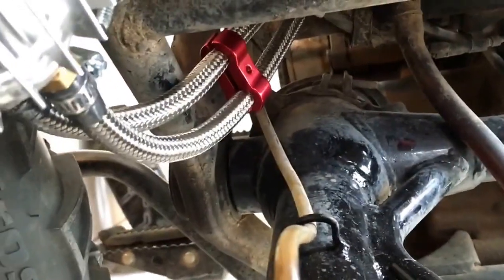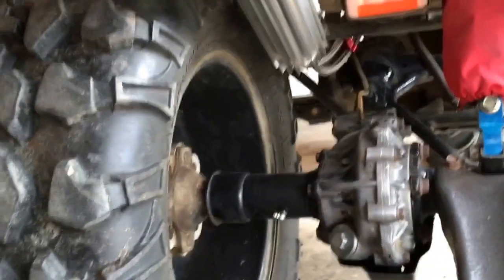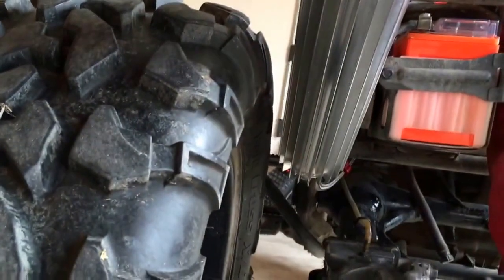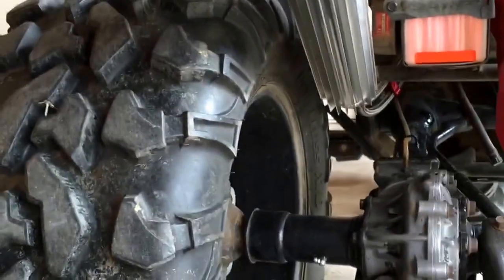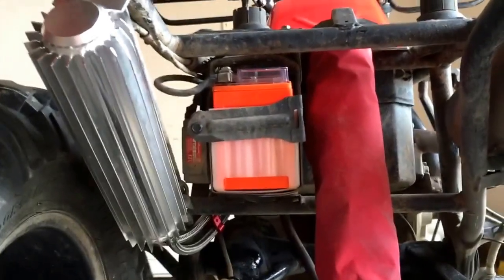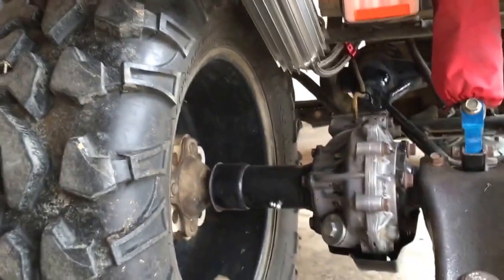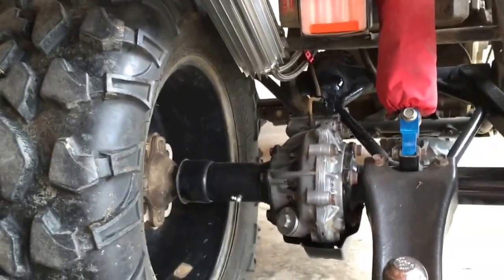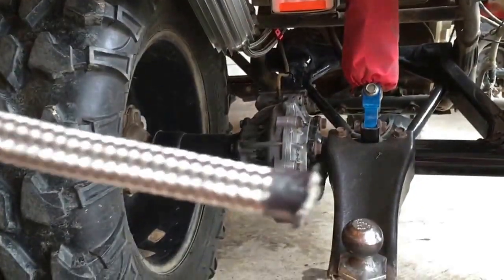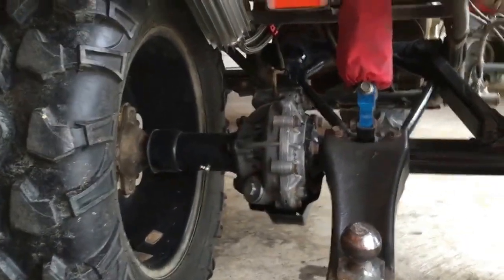In all eventuality, the tire that's spinning next to the cooler is essentially my fan, so we've got plenty of circulating air. I can't think of any downside so far to having this oil cooler connected. I hope I gave you enough information — everything you're working with is quarter AN stainless steel line. Tape it before you cut it.